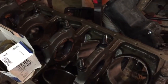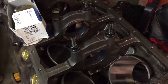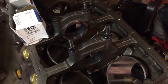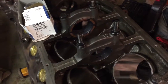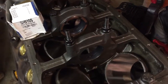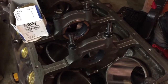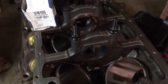Well, hello again. Hope you'll forgive me — I'm a little under the weather, having some trouble with a cough and sniffly nose, but we're going to try to make this video anyway. This video is going to cover the cam bearing installation. We're still waiting on pistons and heads, and we've blueprinted everything we can — the cylinder bores, the main bearings on the block, and the journals for both the pistons and the main journals on the crank. We're pretty happy with the numbers so far.